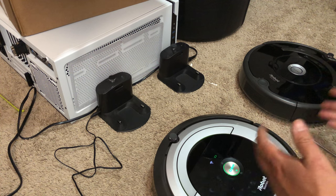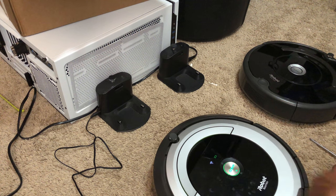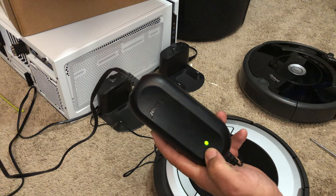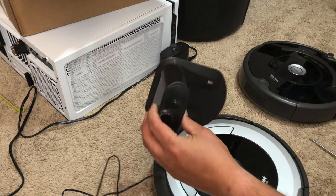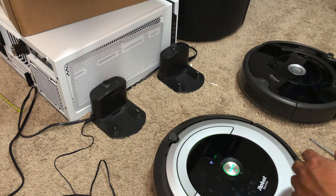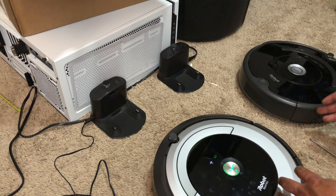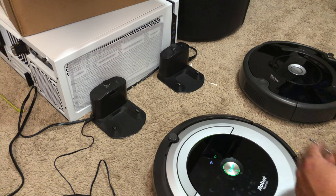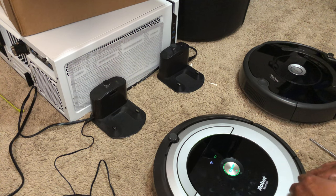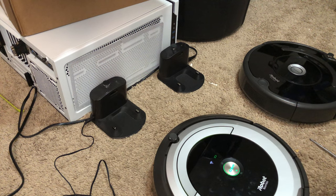With that being said, I hope this helps you find the issue of why your robot isn't charging — whether it's the power button, whether it's dead and you just need to place it manually, or whether it's the battery. If you put your robot on the charger and the green light comes on but it never charges, it might be your battery. Thanks for watching. If you have any questions, leave them in the comment section below. I'm more of a Shark Robot repair guy, so when it comes to iRobots, model numbers aren't as fluent with me — I apologize in advance for not having all the specifics on model numbers and chargers.